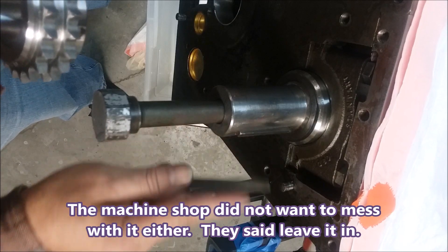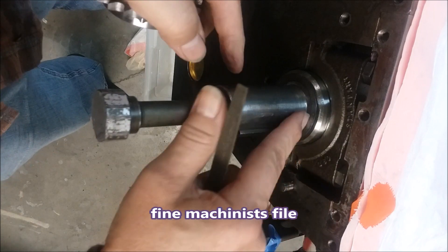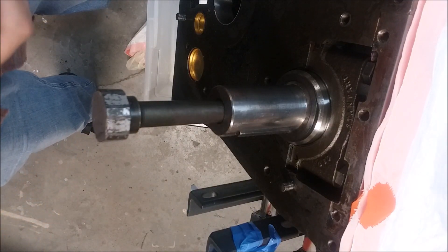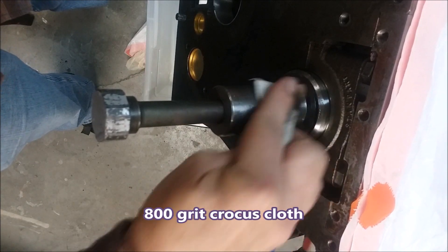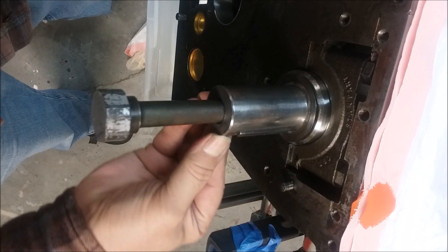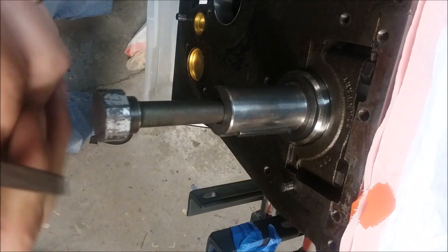What I'm doing here is I'm not filing away on the crankshaft wholesale — I'm finding just the little nibs and taking those off. Then I'm taking a piece of crocus cloth, which is for polishing, and polishing that up afterwards, trying to get this thing to fit on. Initially there were real problems right on the leading edge, and I addressed those with the file.